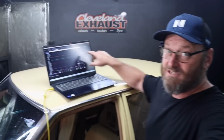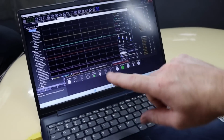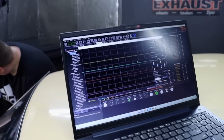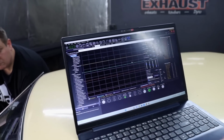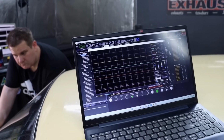One of the really cool things about the NSP software update on the Haltech Elite and Nexus series is the built-in scope. Super handy for stuff like this. We can see whether we've got the sensors' polarity correct. If you change that reluctor polarity, it will also be around the wrong way as far as the ECU is concerned. So we're looking at that now. We can see that both of those sensors are wired the right way, and now all we have to do is look at what their voltage peak is, and then we can set trigger arming voltage, so what the ECU can expect to see as far as what that reluctor will output at low RPM.